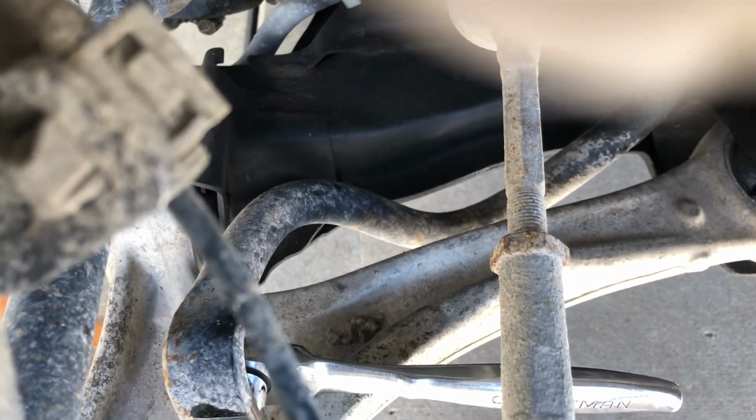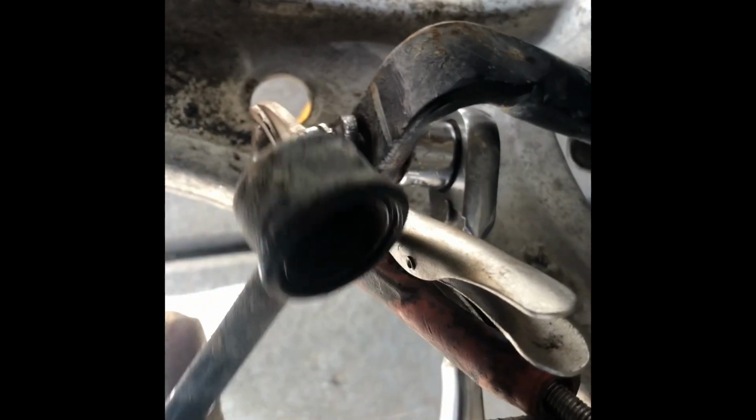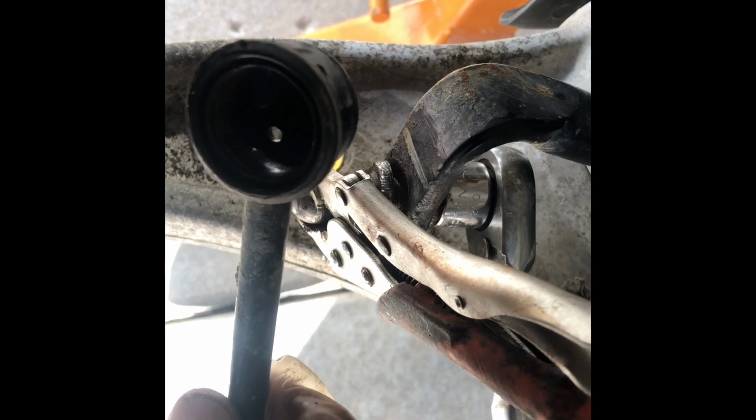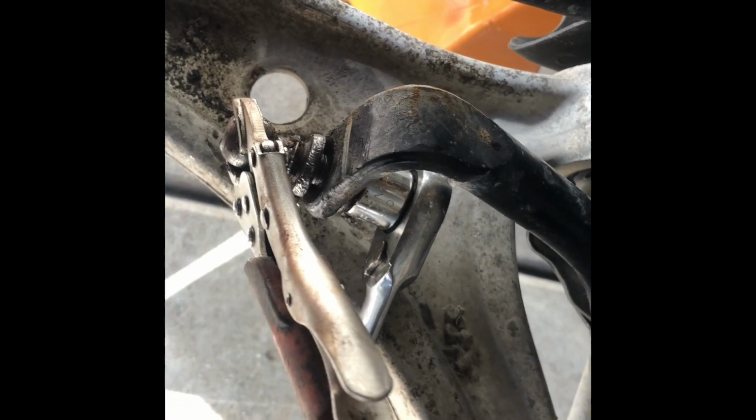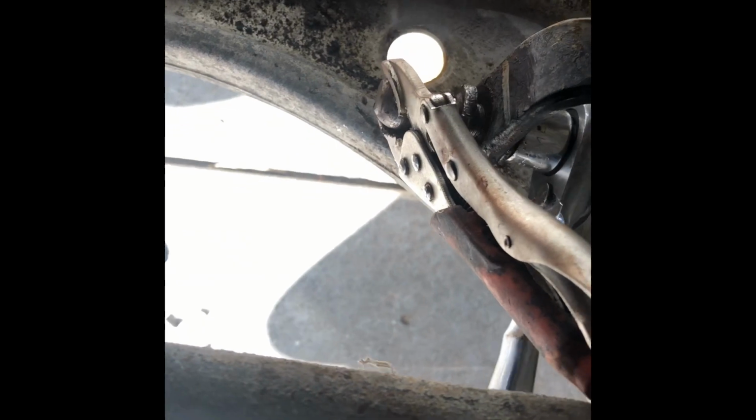How bad is this thing? I have to pound it with a hammer. Yep. Yeah, this is such a pain in the butt. So what ended up happening is I just yank this out, because my vice grip is not gripping. These are like the Harbor Freight vice grips. They're not really good at all. And I don't know where my vice grips went. I have a Craftsman one and I can't find it. But yeah, these sway bar end links are terrible to work with if they are really seized or very rusted,